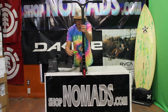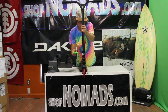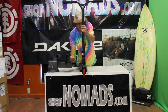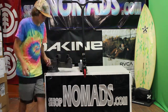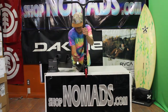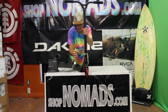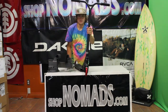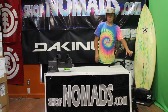An important thing with tightening SCS is you don't want to tighten each bolt too much, so you just tighten them all in evenly, one by one. Don't crank it tight all the way until they're all evenly tightened. And then finish tightening each one. Just give it a quick crank. Crank until it tightens up. Nice, and lift your scooter, nice and dialed.